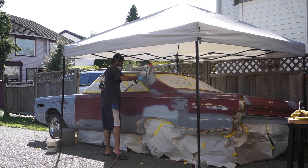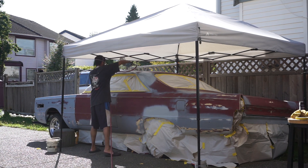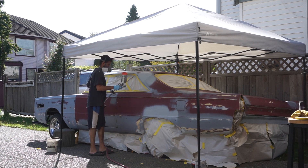The first step I did: after I was all sanded down for paint, I got it in 180 grit with the DA. I blew everything down with an air gun, then I hit it with a wax and grease remover and let that flash over.